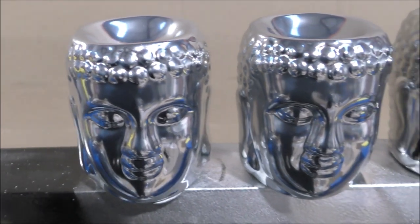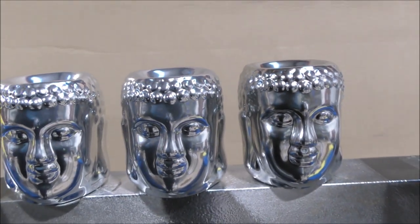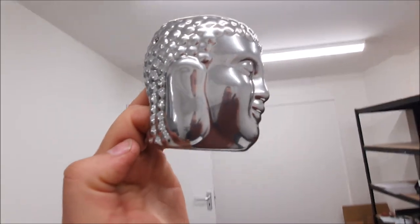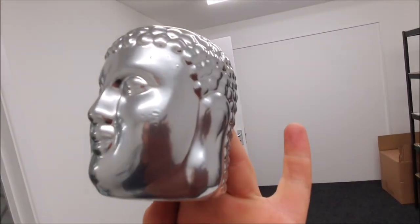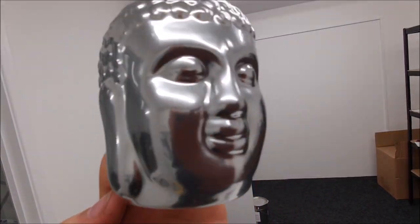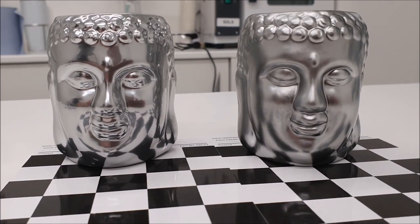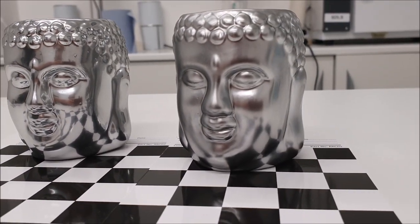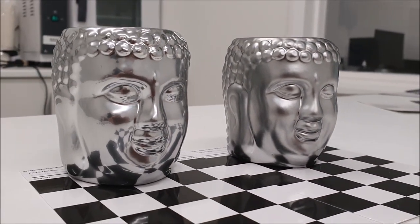Here is a final example of a clear coated finished product. All we've done here is applied two mist coats of Multi Clear 2HS clear coat, followed by one full coat, and this is the final result. This is without even using a water-based binder — a water-based binder can also be used to get good results if you are reducing the flash off times. Here we have a clear coated example on the left and a matte clear coated example on the right.